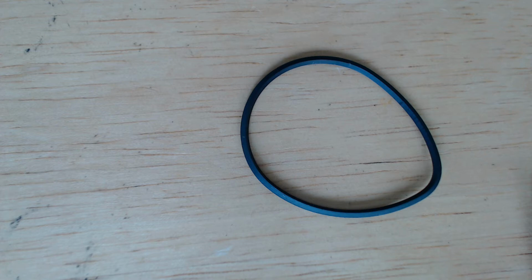Treat this as your inside dimension and then buy one belt size under this dimension. Now back to my first scenario I didn't finish with. Here's a method I recommend to determine the belt size that you actually have right now.